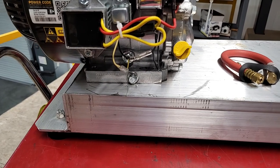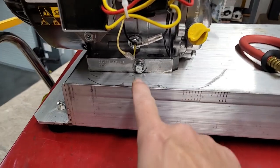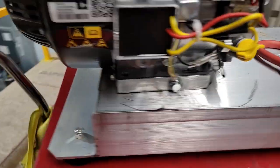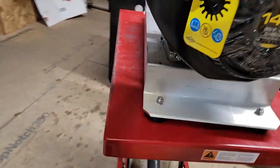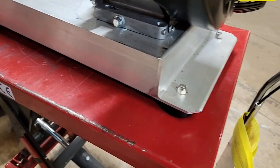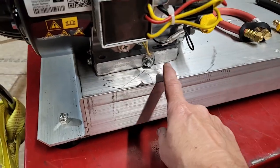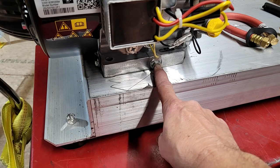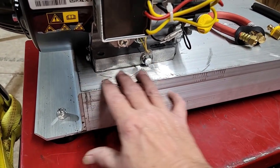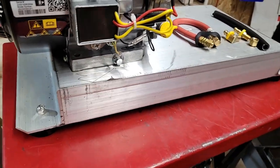I don't have this mounted on the skid yet, but it's there for you to see. This is one of the oil drains for this unit right here, the other one located right here on the other side — pretty much the same predicament. I'll show you why: you get ready to change oil, you pull this plug out, and that oil is gonna go all over this frame under the engine. What a mess to clean up — we need to make it a little more simple.